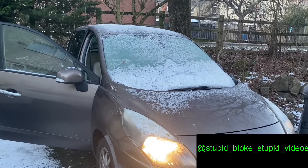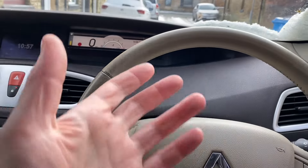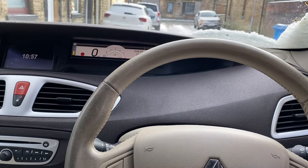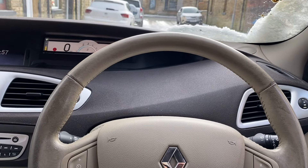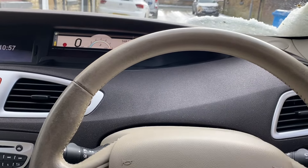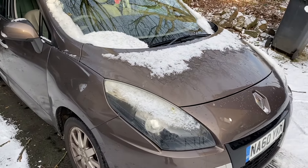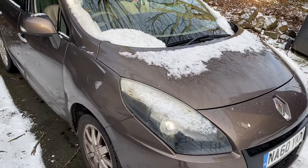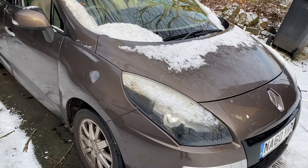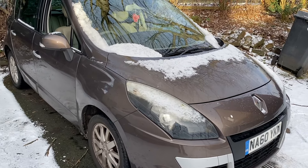Don't forget to like, comment and subscribe - all the usual. But unlike the Volvo I did a bit ago, I did actually code the injector on this - I borrowed a tool to do it. And as you can hear now it sounds more like it should - it's not knocking. I thought the knock might sort itself out because it was cold, but it didn't until I got it dialed in. So now it's all dialed in and it's much better - it seems to run as it should. See you next time, bye.